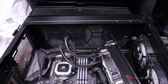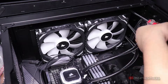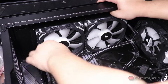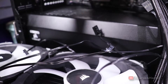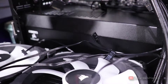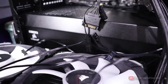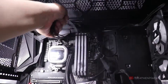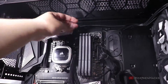After installing the CPU water block and pump onto the motherboard, let's install the radiator. I have already installed both the fans and the radiator onto the fan tray. I removed the radiator here so that I can insert the cables onto the cutouts easily — you don't have to do this if your case is different. Then all I need to do is stash all the cables to the back of the case and manage them there.